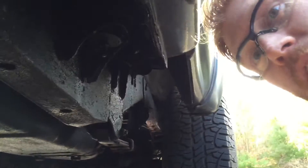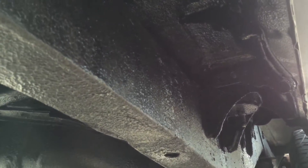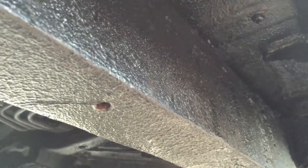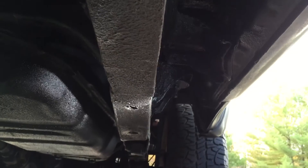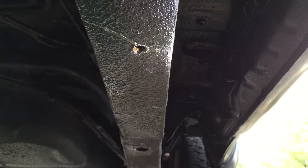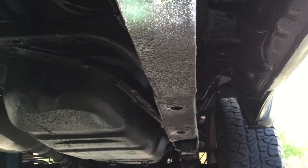Just before winter, I had everything sprayed with a heavy oil both inside and out, just to prevent any further rusting. There are also drainage holes here in case any water gets in — it has a place to get back out, because there are plenty of places along the frame where water can get in. It's really important that you let it back out again. This may have been another flaw with the Toyota design.